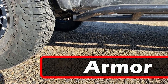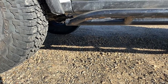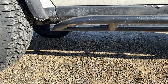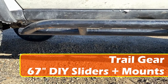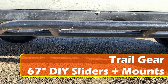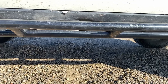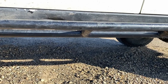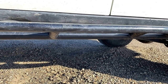Now armor - we're starting to get into some of the things that really make or break my capability. These Trail Gear sliders are pretty awesome and I've been really happy with the performance from them. I had them professionally welded onto the unibody rail; to do that you have to cut the pinch weld just for the rocker panel. You can see I have some dents from before I had these - and these have just saved my butt. I'm laying these on rocks and pivoting around them way better than crunching your rockers all the time.